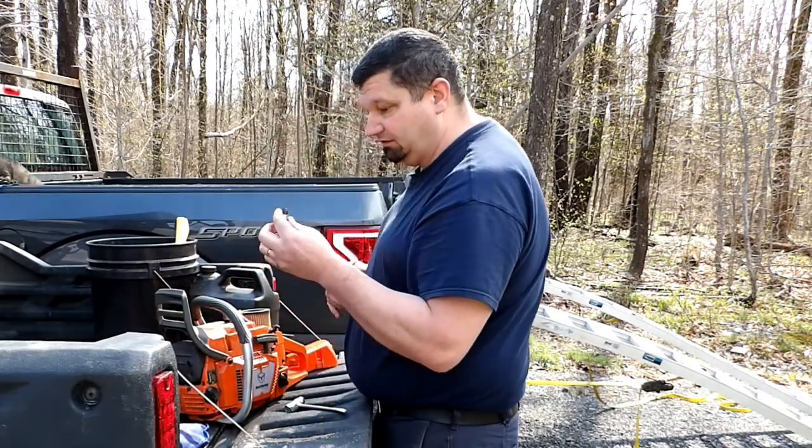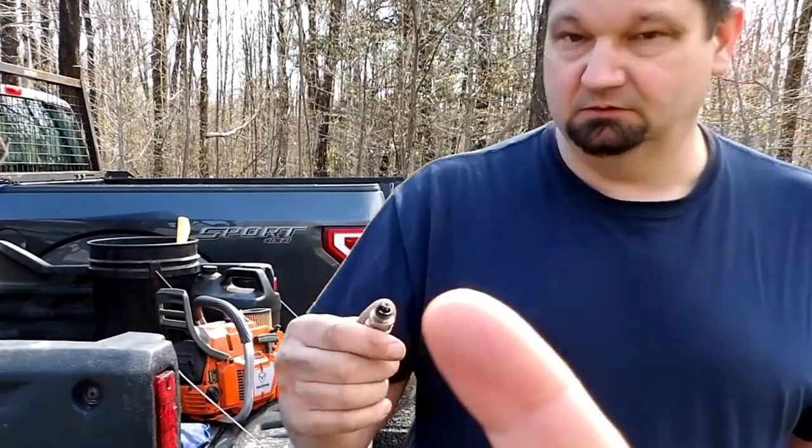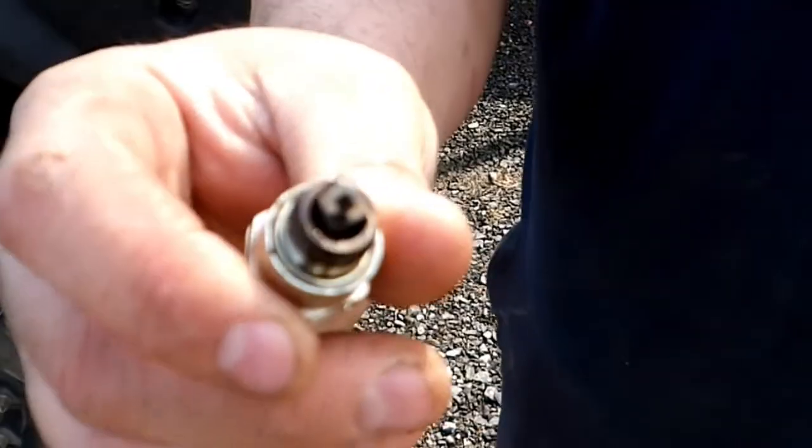Well, let me get it. Bring it up to the camera. Hold it right about here. So that white, it's just a touch on the lean side. You see where it gets kind of brown back here? That's more of the color. You want a nice tan color is what you really want.